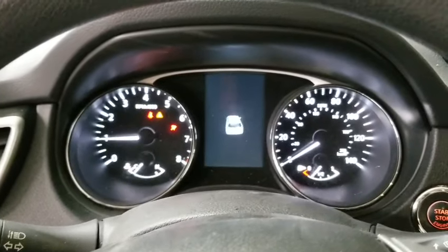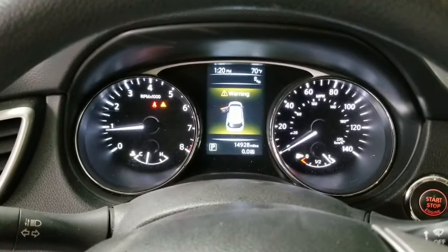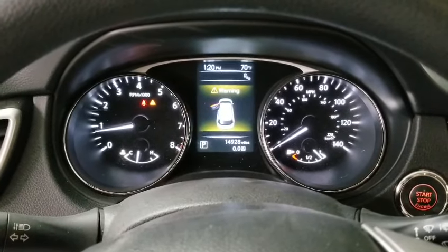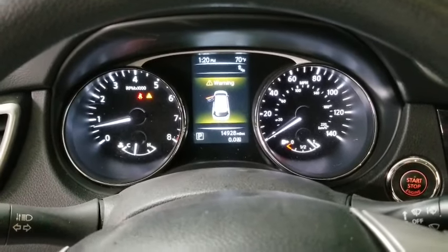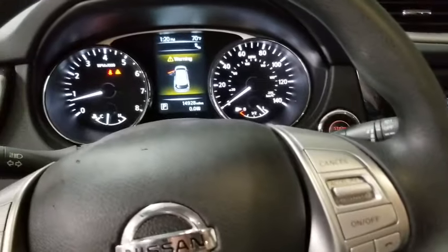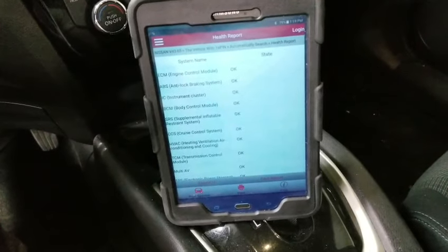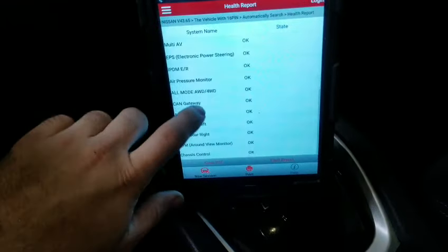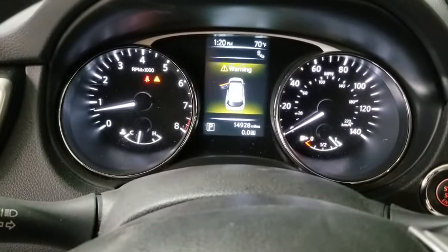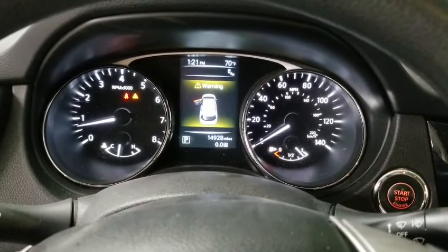It came on, it went off. My airbag light is gonna go off in a second. As you can see, it's not coming back on. That could have your head spinning even with a scan tool, because a lot of times if there's a fault in the system you connect the scan tool and it'll give you a clue where to look for a problem. But right here, as you can see, all the systems are okay and the light was on. The only light on the dash now is my seat belt buckle. So that's it for this video — this was George with Melnick's Automotive. Thank you for watching.